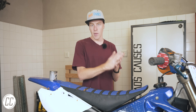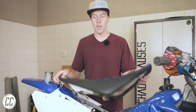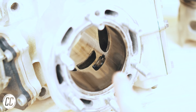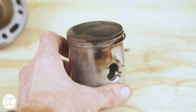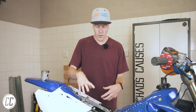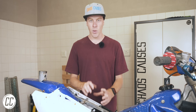If we're looking for the cause of damage, we have to consider everything that goes into the engine. One of the main things is air, so we should talk about air filters. Please excuse the dirty bike — I rode it yesterday and I'll wash it this weekend — but it kind of works here because we have a dirty air filter in the bike. The damage in the cylinder could have been caused by a ring catching a port, but there's no visible damage on the ring or the piston. So the other option is that something got into the engine through the air box, which is most likely the area that caused the damage, at least under my watch.